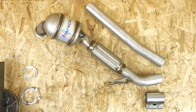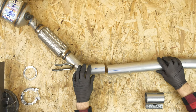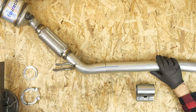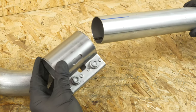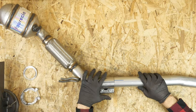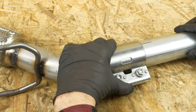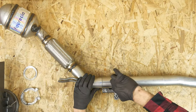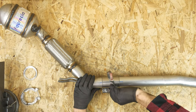Take the catalytic converter as well as the tubes supplied in the kit. Take the adapter sleeve in order to connect the two pre-prepared elements, each marked with a blue line on their sides. You have to bring together the two blue marks on the tubes and slide the adapter sleeve so that the centre links up with the contact point between the two tubes. Once properly in position and using a 13mm spanner, screw the two nuts on the adapter sleeve, which will create a complete seal.